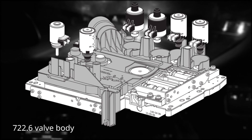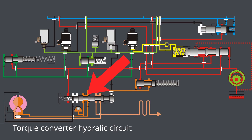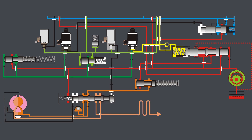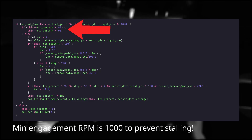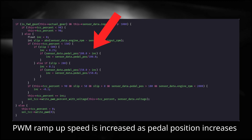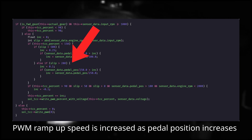An automatic is supposed to feel smooth when the clutch is engaged. The clutch engagement happens hydraulically by activating the torque converter solenoid, which in turn moves the valve in the valve body of the gearbox, which then sends main line pressure to the torque converter clutch. The pressure is regulated by pulsing the torque converter solenoid at around 100Hz, which moves this valve back and forth very quickly, regulating the line pressure being sent to the clutch. The current torque converter lock up code starts at 9% and slowly ramps up the PWM signal until it notices the slip between the engine and the input of the gearbox is less than 200 RPM, at which point it assumes it is locked up. By design, this gearbox does not fully lock up the torque converter, as this would transfer engine vibrations to the rest of the car, making for an uncomfortable ride at low engine speeds.